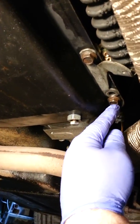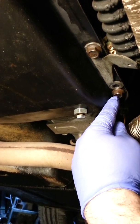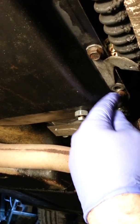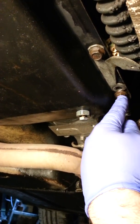The only other couple of mods — I'll have to figure something out here in the future: where the 700R4 bolt holes are a little closer together using that bracket, the TH350 is a little further apart. So I bolted one end for the shifter lever, and the other one is kind of just pinned down underneath the other one.